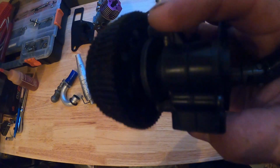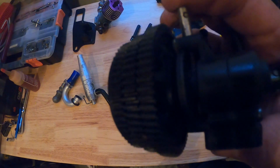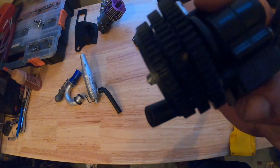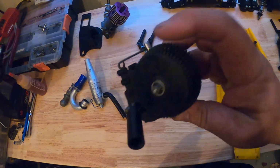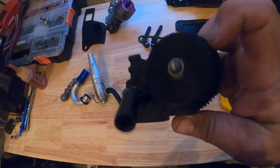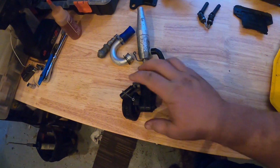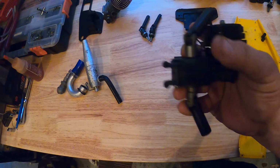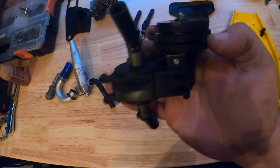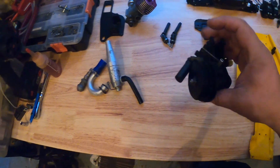The grittiness was actually between the disc brake and the brake lever itself, and I ran it along. I put a little bit of drag on it and spun it a few times, and it felt really good, and I didn't feel the need to take all the way apart. I took the transmission apart and lubed up all the bearings and put it all back together, and all this stuff feels so much better now. Even turning the rear axles to the transmission, it feels really good. I'm actually turning it in my hand now, and it's not gritty at all. So we are ready to fly.